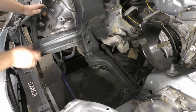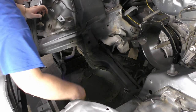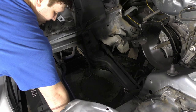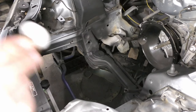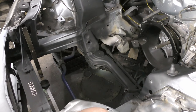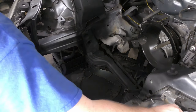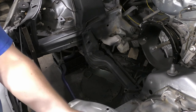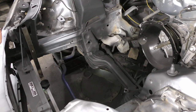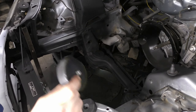And slide the radiator right on top. So you can see our bottom radiator support here, and our hockey pucks just go right over — we've got the thread inserts so they just go right over on both sides. That countersink on the back side lets it sit flat on the surface, and I ran enough room for a one-inch washer to go with a quarter-inch stainless bolt — about an inch long. This allows you to run it right through the hockey puck.